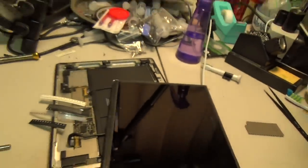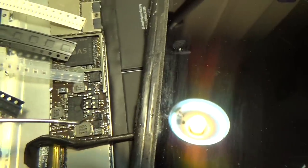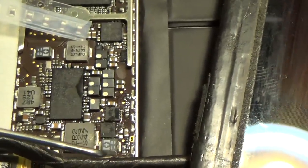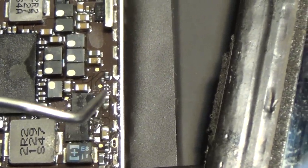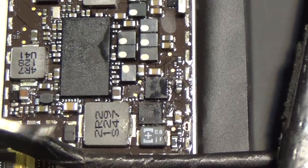This is an iPad 2 that was fixed. It was sent in to get the USB power fixed — it wasn't charging before. As you can see, this is the USB filter. I need to be careful not to touch this component with my dental pick because right now it's plugged in and it's charging. These parts are already replaced.